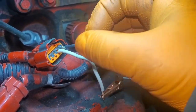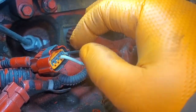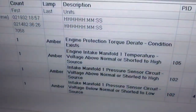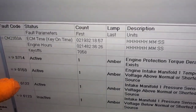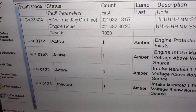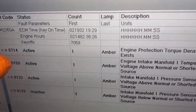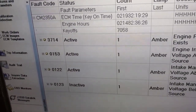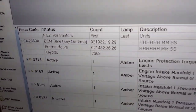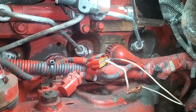If you have two jumper tools use them — I only have one, so I just took a regular wire, stripped it back, and got only a couple strands in there so it doesn't split the terminal. As you can see, it's updated now — I'm getting code 1-2-2, indicating that the signal voltage in the harness is good, and code 1-2-3 went inactive. There's an active temp code only because the connector is unplugged. So this is the bad intake manifold pressure sensor. Clear the code, your d-rate will be gone, and after replacing the sensor you're all set.